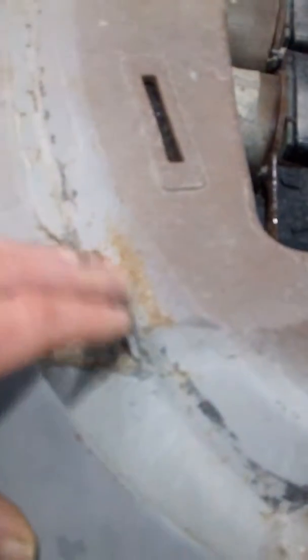I wanted to show you guys this — this is what happens when you put them in primer and then they sit for a long time. It's starting to pop up with rust, as you can see through the primer there. That's why you can't shoot primer on them and let them sit around. I don't even know how long it's been, but there's rust starting to pop up through the primer.